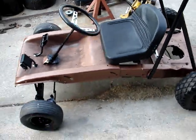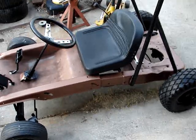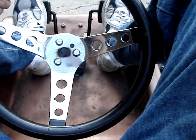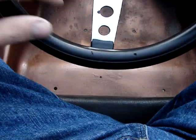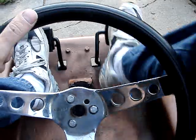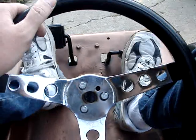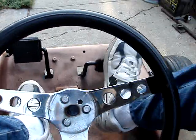If you're wondering how tiny this thing really is — it's not that big at all. I'm not quite six foot and I can still get on it myself. It's a little compact, but that's where my legs are. The steering wheel used to be a lot lower — imagine it way down there at one point. All this does is actuate the belt tensioner: the more you press it like a gas pedal, the faster it goes by increasing the belt tension. It has a manual brake separate from the clutch, which is actually the gas — it's backwards, it's weird.